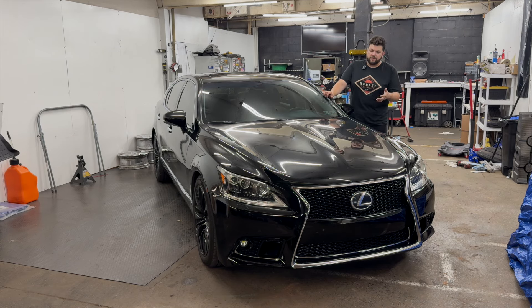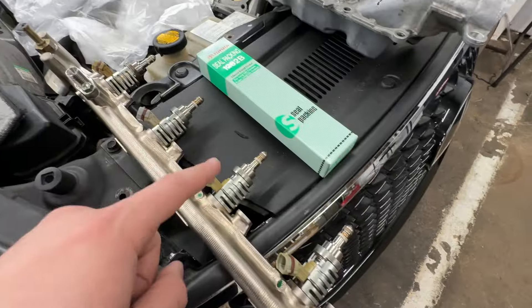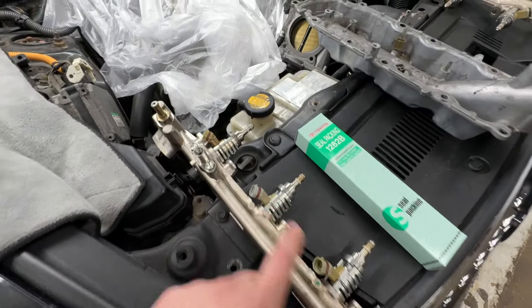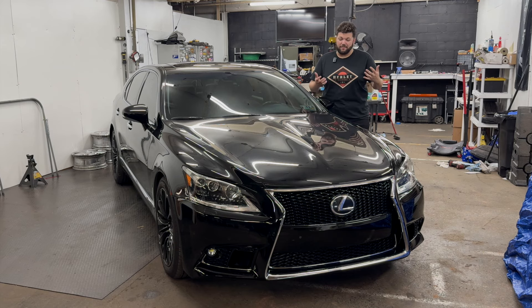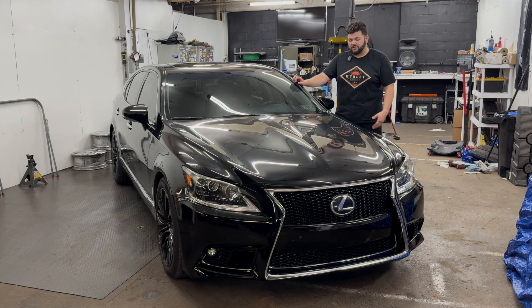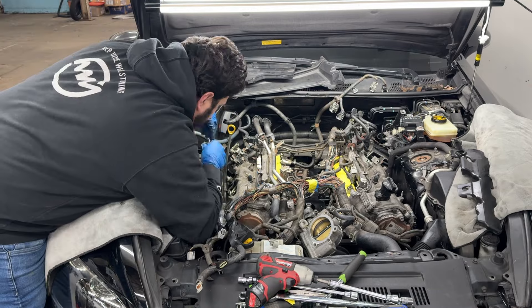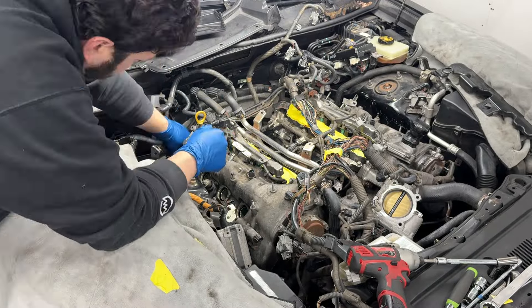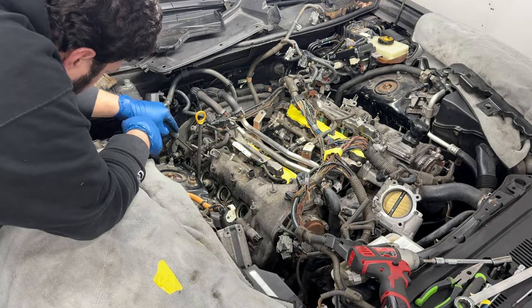Valley plate's resealed, injectors are sealed. The passenger side was fixed with low mileage used OEM injectors. I didn't want to buy new injectors because they are three to $400 each and there's eight of them. So over the last eight months I've been fixing this, troubleshooting it, having it back together, apart again, back together, finding an issue and having it apart again. That happened maybe three or four times, but I really learned this engine — it's either time or money, and I unfortunately spent time.